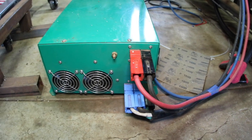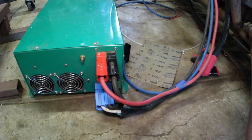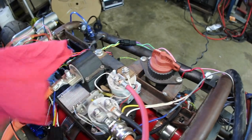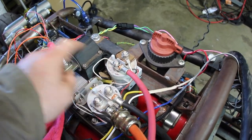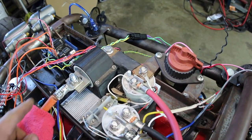First off we got the Manzanita charger — got this on discount. It's a high voltage setup for 50 amps, and I am hooking that straight up. Follow the little wires to the BDU. This goes to the negative contactor and the positive contactor. Positive contactor goes through a pre-charge circuit, and then to the fuse, and that's the output to the motor.